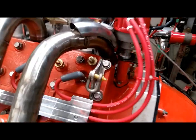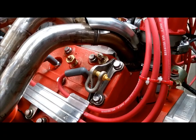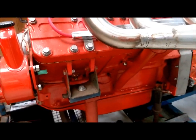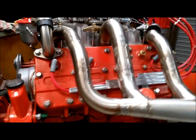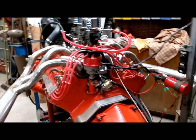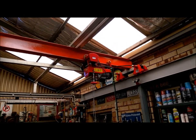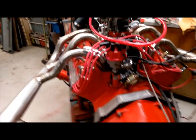I've gone to the trouble of making some purpose-made hitching points at the heads, as these engines don't have a lot of places to hook onto or put bolts into. The exhaust pipes at the front could also interfere with the engine mount if I hook chains on there — I'm not sure how that'll work yet. I've made a lifting device, and I would suggest that anybody without a tractor or a two- or four-post hoist would need to think seriously about having decent lifting gear. My lifting gear is a homemade gantry with an electric winch that will lift at least 2,000 pounds, I'd like to believe, so I'm hoping that will get me by.